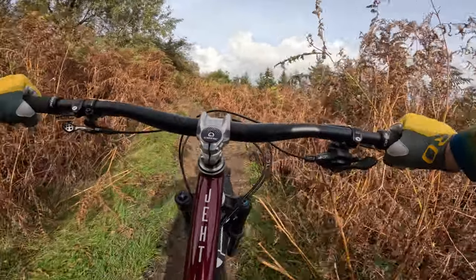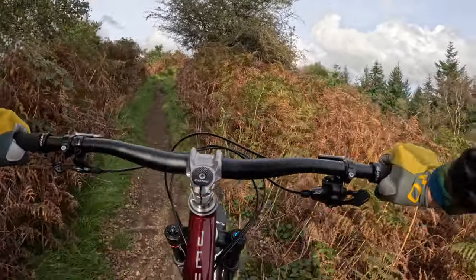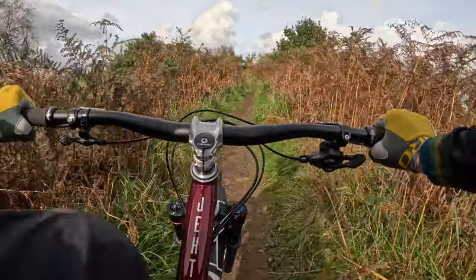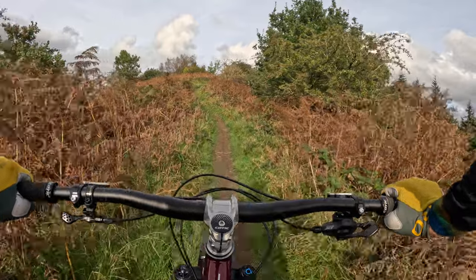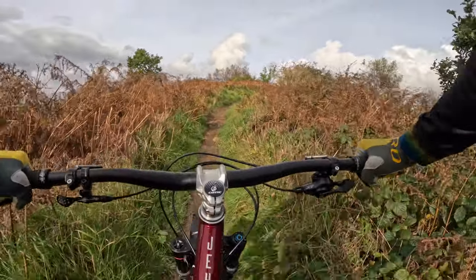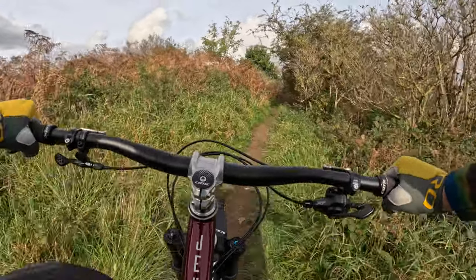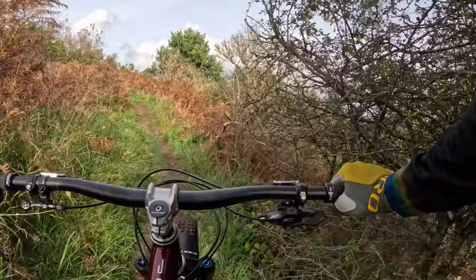And obviously, this ultimate spec Super Deluxe gives you loads of adjustment in terms of low speed. So you can set it between sensitivity and firmness. But it works really well. It's not like a sweet spot setting. It just gives you lots of ride feel options when you want a poppy supportive bike or something a bit plusher. But silver spec bikes come with the Deluxe Select Plus, which is basically the same damper without the piggyback and without external adjusters. So it's lighter, but you're getting the same control, less faffing with dials.